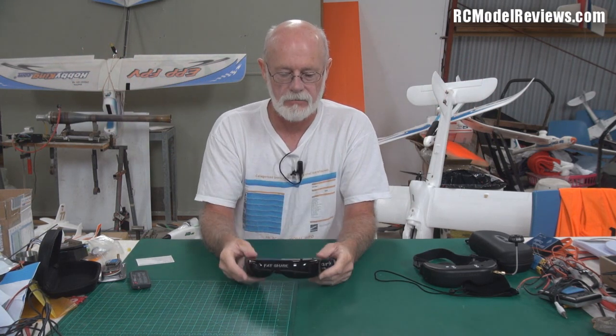You're sitting there almost surrounded by the image displayed on the little LCDs inside, and that's brilliant — but there's a price to pay. To get that very large field of view you need powerful magnification, and you can see there are some really powerful lenses in here. Unfortunately those lenses are made of plastic, and as anyone who knows optics will tell you, plastic lenses end up not being very good — you get colour fringing around the edges because different colours of light bend at different rates, giving chromatic aberrations and a lack of focus.